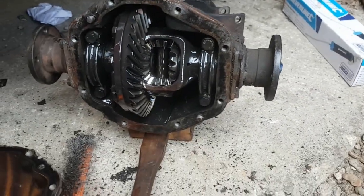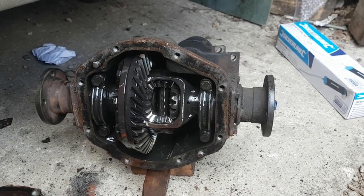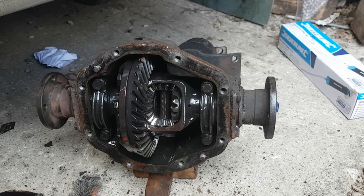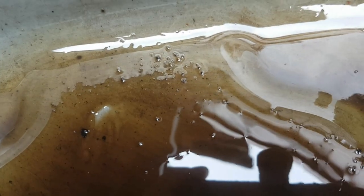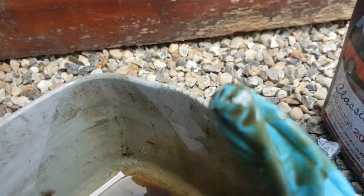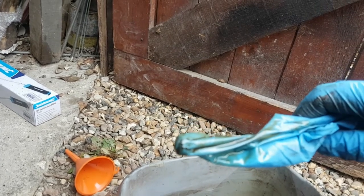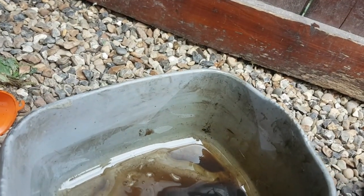I investigated and got the diff nose out as well. The only thing I can really find to justify this is that the oil I drained out of the differential — about two pints — is absolutely full of swarf. Little lumps of metal. It's magnetic. I've got a plastic glove over the magnetic probe and it picks it all up. Something fairly substantial has happened in there; there are big old lumps of swarf. Something's gone bang inside that differential.